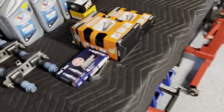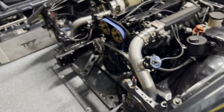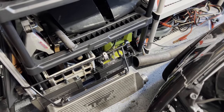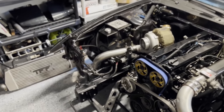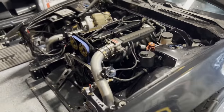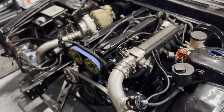Next will be the oil and getting this thing dressed and done. Once that's done, put the front end back on and continue with the swap. Hopefully the new oil cooler comes in next week — Andrew is working on it but the cores are on back order. Once it comes in, the oil cooler lines will be remade and we'll clean out the oil sandwich plate to get all the crap out before going back on this fresh motor. If you've been through what I've been through, always replace the oil cooler, redo all the lines — it'll save you a lot of money and time. First up: spark plugs, gapped at 21.